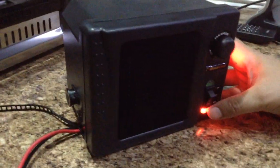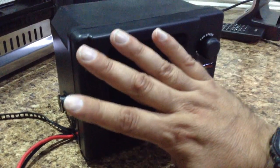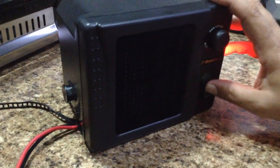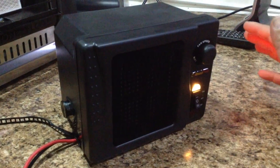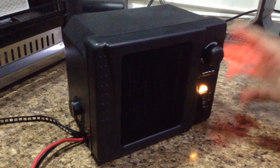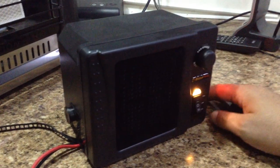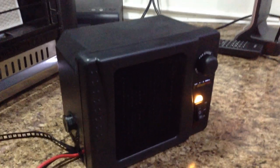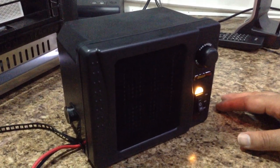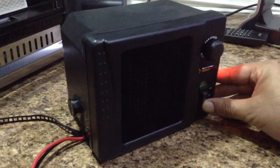The switch setting is really simple — that's the heat setting. Once I turn it off, the ceramic is heated up so there's still some heat circulating. You can run the fan and still scavenge some of that heat without the heating element itself going. What will happen is it will eventually cool off. But if it's getting late and you're worried about power, you can still get some of that residual heat just by running the fan.